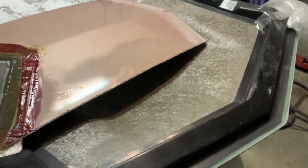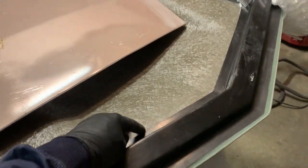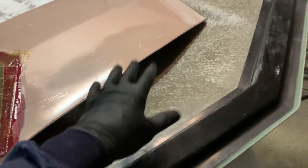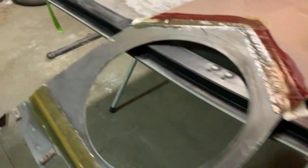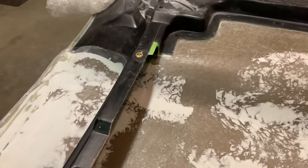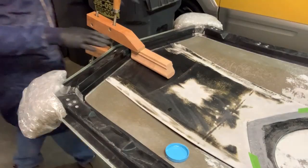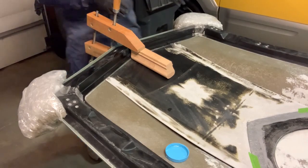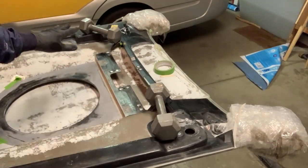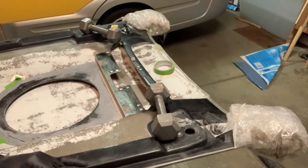I don't know if fiberglass resin is glue. It seems like it should be, but why is there epoxy resin for fiberglass then? I don't know. So anyway, I'm going to lay some epoxy right along here, and then I'm going to clamp the front, and then I will work some epoxy in here. This will be a butt joint right here, and over there, and there it's just bonding two flat pieces together. Got the front clamped down good. You should get a good bond there. And I've got a couple of weights on this side holding those pieces down, being held on by the fiberglass epoxy.